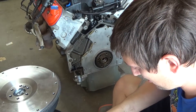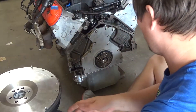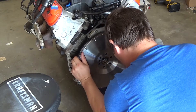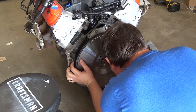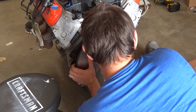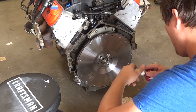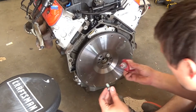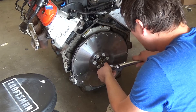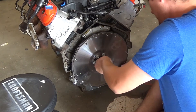There's a little dowel here. I'm going to take all these bolts and do it kind of backwards. I like having it on a setup stand like so and align it with this. Put a bolt in there just for safety measures — as if that thing flies out, that would not be fun at all. So we're basically going to do that. You go in three sequences: 15, 34, and 74 foot-pounds is what they said for your tightening sequence.